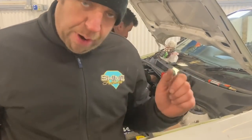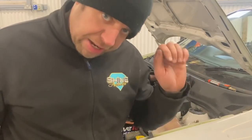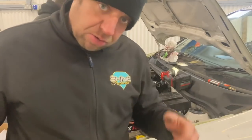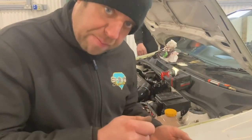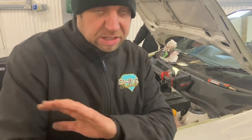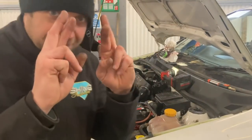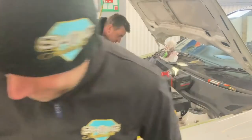Got a screw on the pump, so what we're doing now is just getting it set in the right position, because whoever had it before us had wound it right in, so it was overfueling. So we're just getting that set up in the right position, and then the engine is dialed in, thankfully. I hope so.